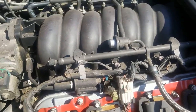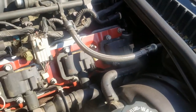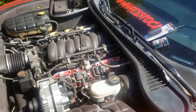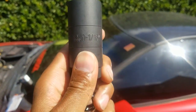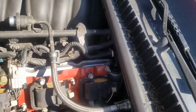I might have to take these fuel rails off - I'm gonna see if I can get to it without taking them off. The sensor is on the driver side behind here, way back there, hard to see. I can't even see it but I'm just gonna feel for it. I don't have the thickest hands so I should be able to reach in there. Got my ratchet, extension, U-joint, and this socket - it's a one and one-sixteenths. A 27 millimeter fits too but I didn't have one.